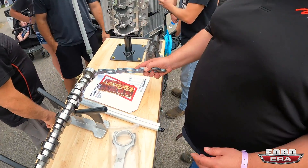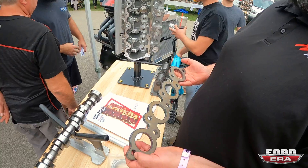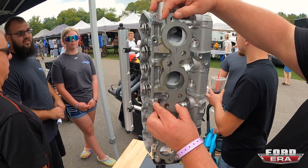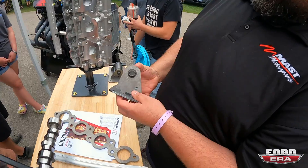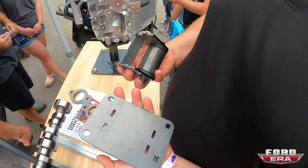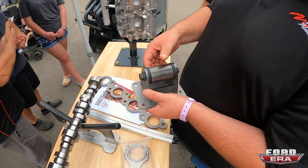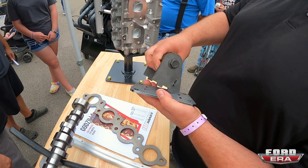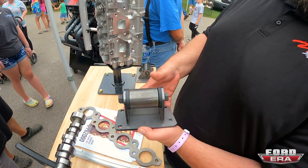This is an exhaust flange — since people are swapping these into cars and trucks, we wanted to come out with a really nice flange that's already matched up to the bolt pattern for the Godzilla, so you can mount your own headers and do your own pipes. We also offer swap mounts — do-it-yourself builder kits that mount to the Godzilla with a really nice rubber bushing flange. All you do is mount that into your frame and that into your engine, and you're ready to go. They're universal, so you can flip them around and move them to different mounting points for your chassis.